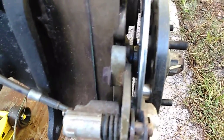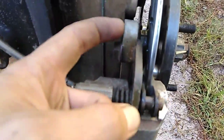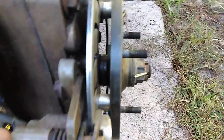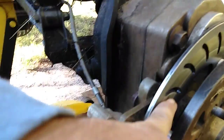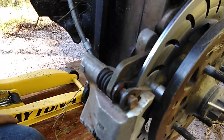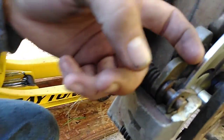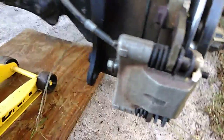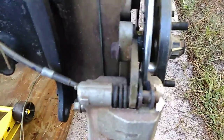Okay, so about 6 months later, they did finally make a new mold for these and send them to me. The reason I was so concerned about it was because these slotted rotors are huge, and they eat through brake pads already. With about 15% of your brake pad material hanging out past the rotor, I was going through pads insanely fast. So they took care of that.